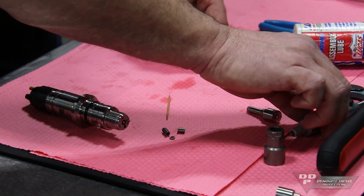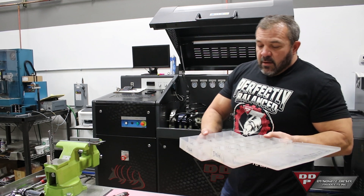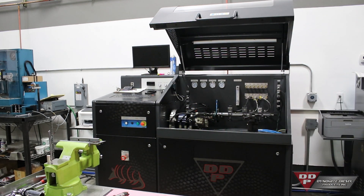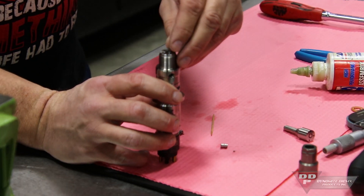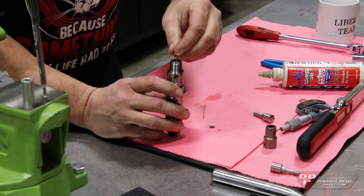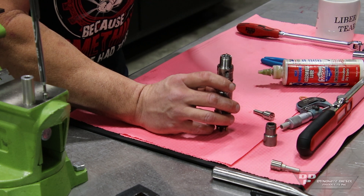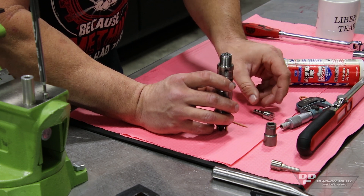The DNH shims — we have various options in stock — help balance out the overall needle travel. The first thing I'm going to do is make sure I've got all my parts in this injector: DFK, spring, DNH. They don't always like to lay in flat perfectly, and this is where the toothpick comes in really handy. It's non-magnetic, it's just the right size, and as long as you keep it clean it ends up being a great little tool.